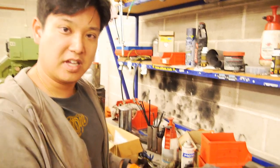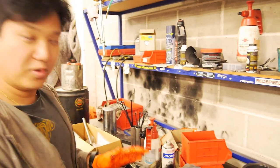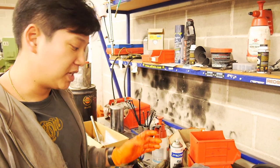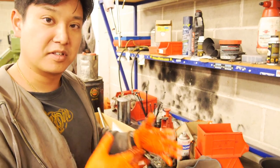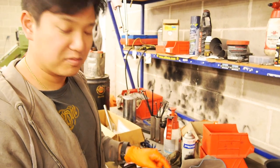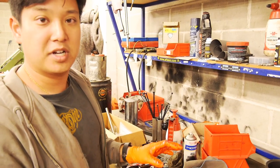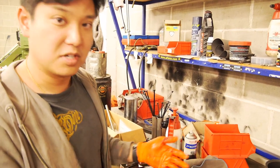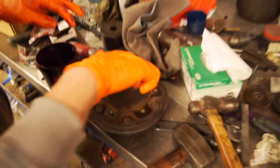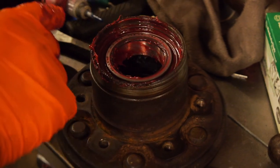I'm just going to coat the rollers with the leftover grease, make sure everything's fully coated, and seat it down in the cup. I've seen some people fully pack this whole area and jam it full of grease — it's not a great idea, because when it starts up the grease needs to egress. There is way more grease in the bearing than what the bearing actually needs. What happens with the taper roller: when the inner ring spins up it wants to pump the grease outwards. If you've left no space there, it'll be jam-packed and all that grease will push out against the seal element, and the bearing will tend to run hot because of the extra friction. People can incorrectly assume that was because of excessive preload rather than the inability of the grease to get out. You cook the grease, it loses lubricity, and it doesn't have the life it was supposed to. So I only pack it just so that it's smeared and flush and I'll clean off all the excess grease before I put the seal on.